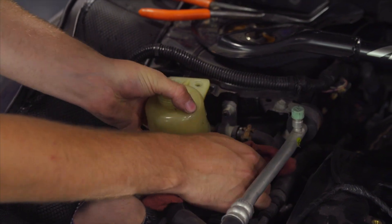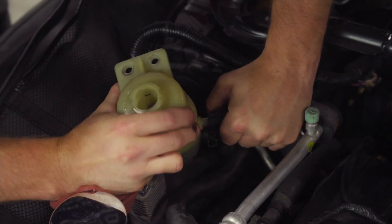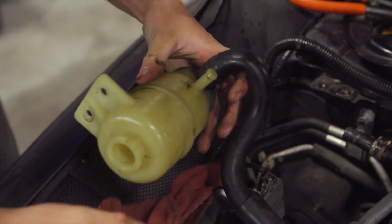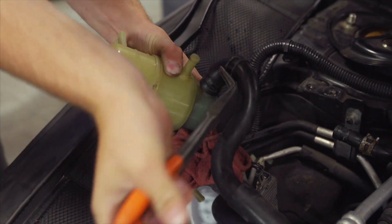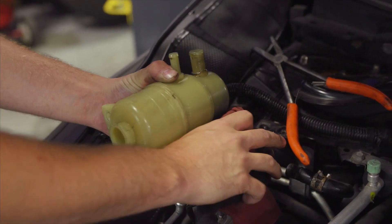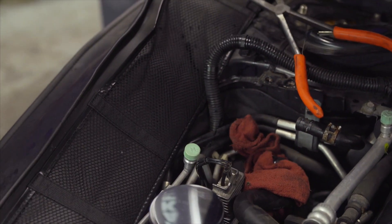There's a little mess here. We're going to kind of go like this — you have just enough room. Now hold it like this, grab your pliers, and move that spring clamp out of the way. There might still be some fluid in the lower hose, so put a rag there. And there you go — it's off.